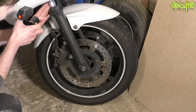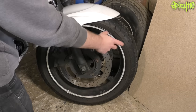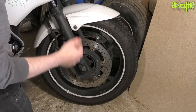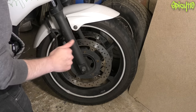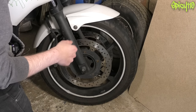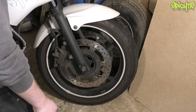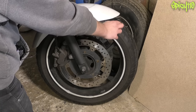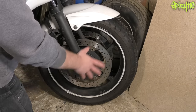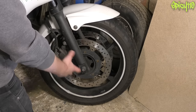Starting on the front bottom of the bike: check the front tyre — make sure it's not damaged, properly inflated, and has enough tread. Over 50cc, I believe the requirement is one millimetre over three quarters of the width of the tyre, with the last quarter having visible tread. My Metzeler Roadtec Zero tyres have tons of tread left. Also make sure there's no wheel damage and the valve stems aren't corroded and about to fail.